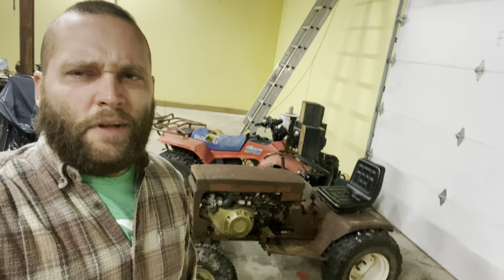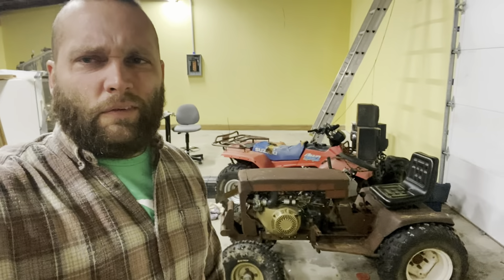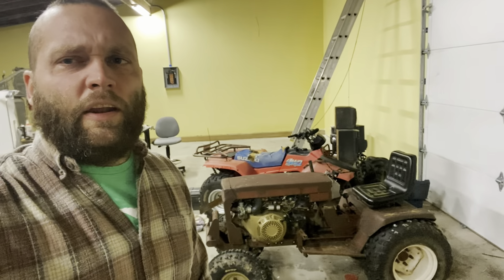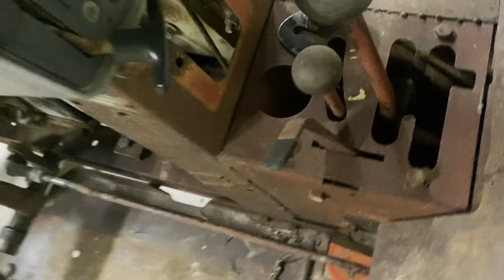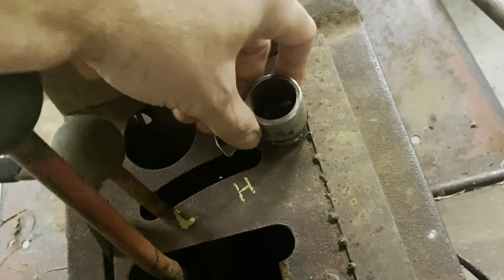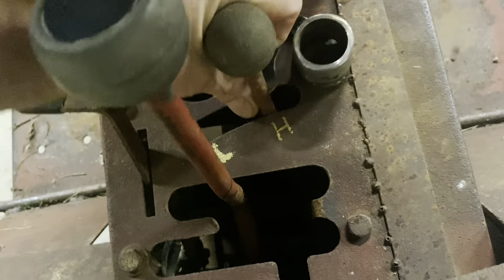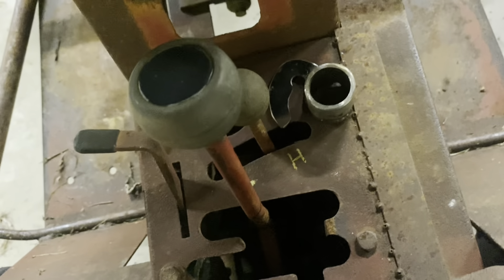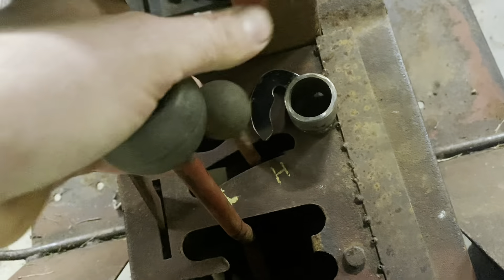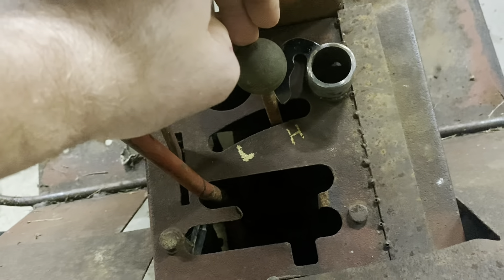It's the next day. I was really looking to get those wheels painted but I don't know that's going to happen due to the current schedule. I did pull it out — rough seats, kicking in and out of gear. I made this catch — it's just on the bolt right here. The idea is you kick it in gear and then kick that over. I need to put a little handle on here and grind this out more so it catches easier. That should hopefully hold it in. It's definitely hard on the transmission doing it that way so I don't plan on running it long term, but it should make it through the Good Evening ranch ride. Then I can bring it home and throw another transmission in it.